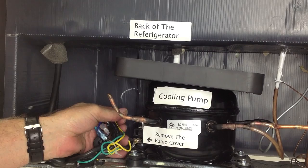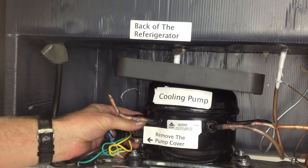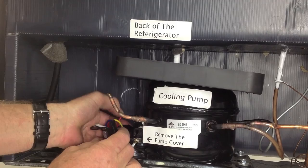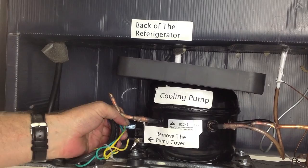Keep your wires straight. The red one slides out — there are three pins that go into the motor, and this one goes on top of the triangle. Pull this one out and put the new one in. The new one is physically positioned slightly differently but it's the same part. Take the piece with the two holes and put it in position — and essentially we're done installing the parts.